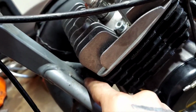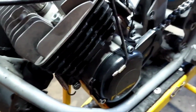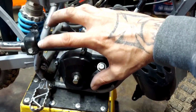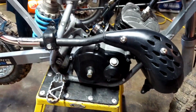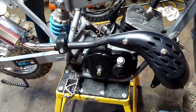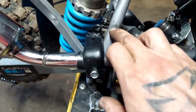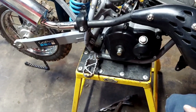You see, the first thing is the exhaust pipe kind of hits the frame a little bit there. All right, not a super big deal. I can notch that out a little bit. But the thing is, if I get over here, let me explain this a little, so you can see a little better. The motor needs to come up and tilt down a little bit. So basically I have to take off these welded nuts here on the top and bottom so I can position it just right, and I may not have to do that. Not the worst. So hopefully I can just cut those off, position it to where I need to, and it should be a little bit better. And I've got the exhaust kind of just marked up into place because this is where the other one was. You can see it was wearing right into the frame. Dang.